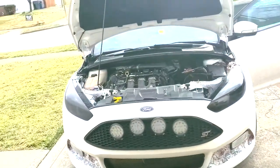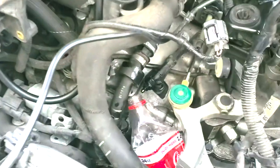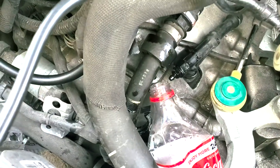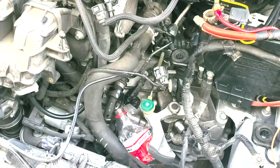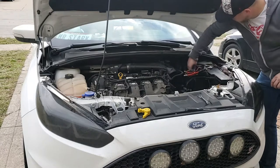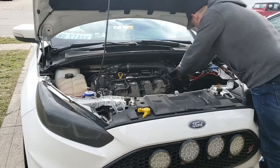We have the clutch bled now — we've got stiffness in the pedal and it's reassembly time. To access the bleed line in future, you won't have to take the battery out — just the intake has to come out to get to this part. I had a little catch bottle but it didn't work too well; there's still a little splatter to wipe up before we reassemble. All in all it took about 25 minutes to get everything bled out of the clutch.